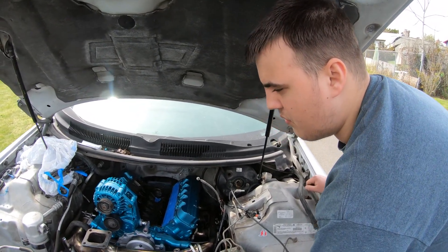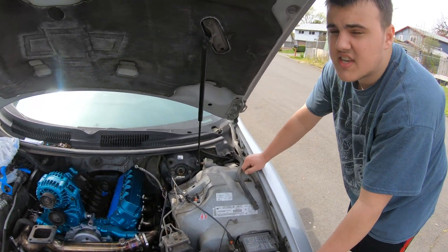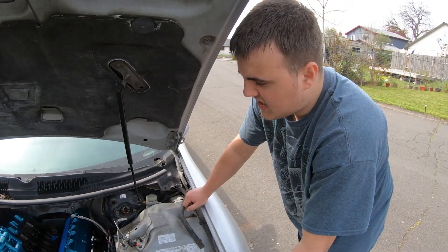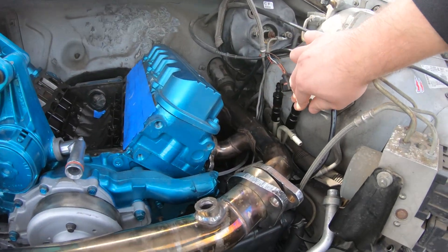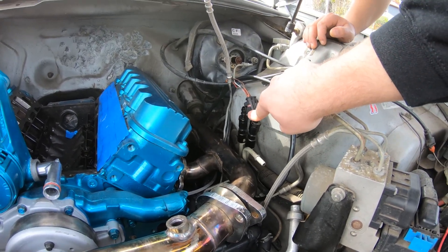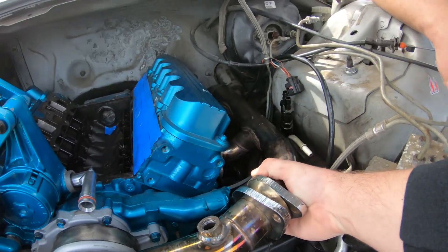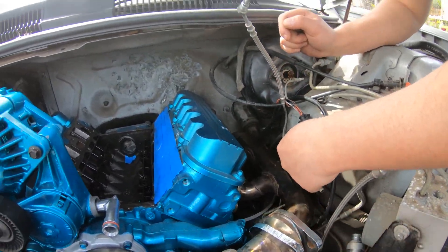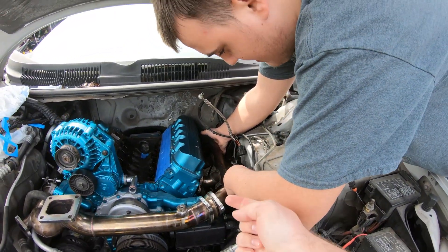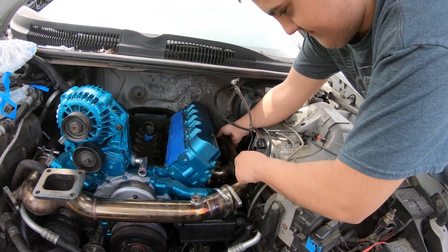We really don't know what we're going to do with the exhaust routing — it's going to be a pain. We're also going to need heat shielding on every line with this setup. There's no working on your car like this with a turbo manifold there. The fuel lines will need to be kind of bent out of the way and probably wrapped. This is not anywhere near where it needs to be up against the block — it's still almost touching. It could still move further that way, but I definitely need to get heat shielding for those at least.